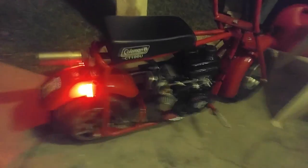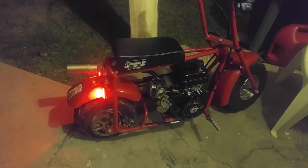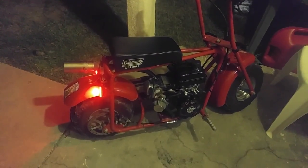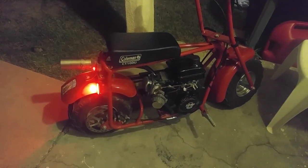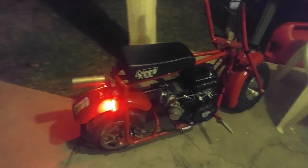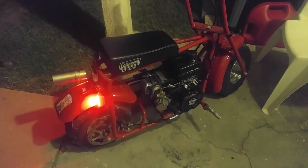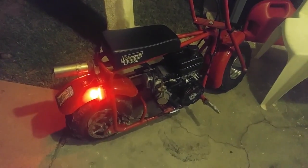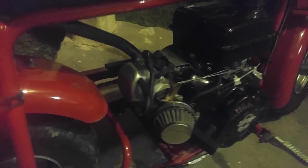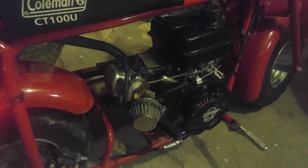She's pretty much on her way up to the next step of what I have planned. I'm going to try to get the heavier valve springs and put them on here — maybe see if they work. But before I do that, I'm going to order them for the Predator 212 first and see if comparatively the valve springs are the same diameter. If they are the same diameter, I'm going to go ahead and do the valve springs on the stock three horse. Like I said, I'm going to give it everything she could possibly get. Spikeman Dan, coming up with the master plan.